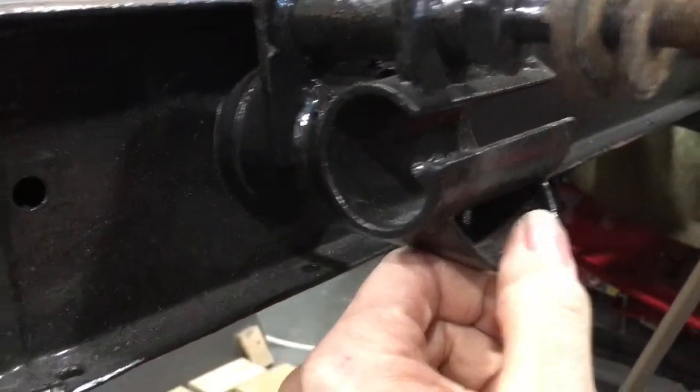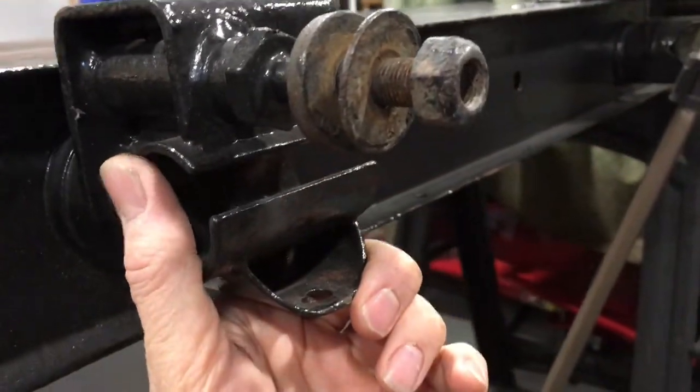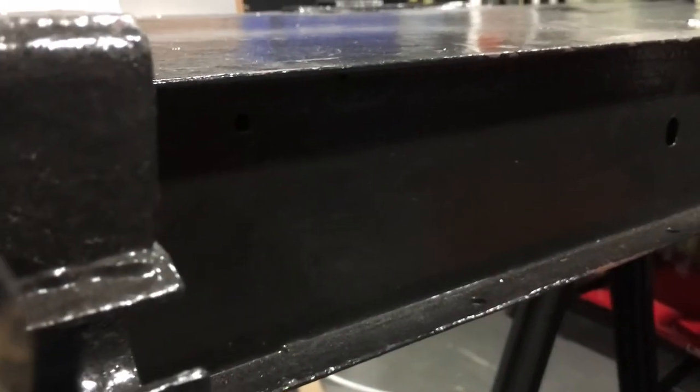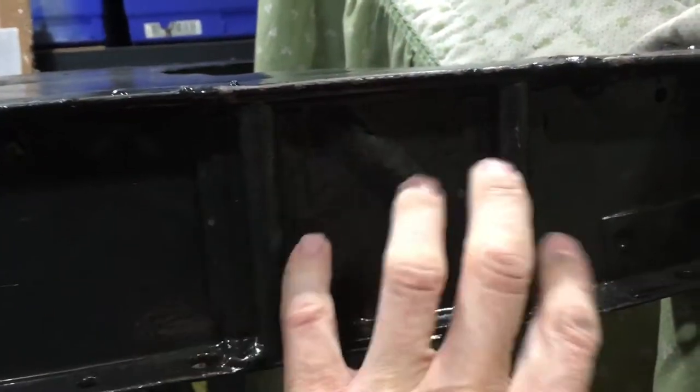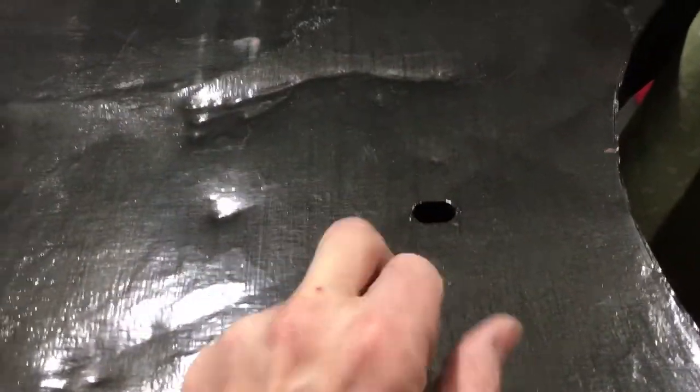You've got these thick steel tubes that run the width of the chassis to which the suspension cylinders bolt on. And again. And in between, you've got this same 1mm steel running down here. Another tube, and here at the back, another stiffener plate, but this one's quite small. It only runs from here to here, just for the actual suspension mounting. The rest of this, it's all 1mm steel, all of it. Here we've got a nice curved stiffener, gives it some strength.